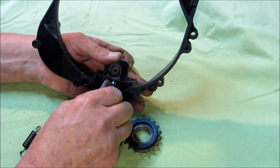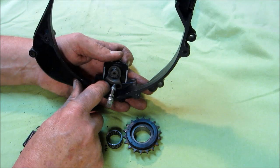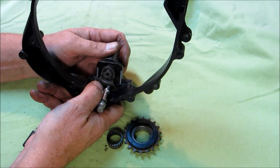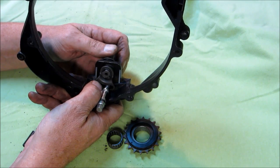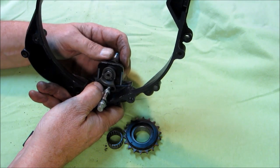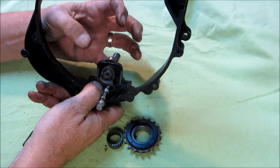One thing that the torsion spring cures — and I could be all wet — but the torsion spring is wrapped around that shaft and works in torsion to pull the doohickey in this direction. And when it's doing that, the only way the shaft can rotate is in a direction that actually tightens the chain. And obviously the chain will not tighten itself, so this tends to vibrate a lot less. The other thing is that the aftermarket doohickey part is machined to considerably tighter tolerances than the factory parts, and it just doesn't allow for that much vibration. That's why people say go ahead, put the torsion spring in and put the aftermarket doohickey in — it cures a couple of problems.